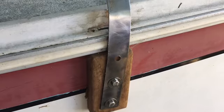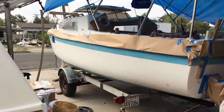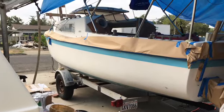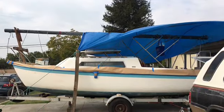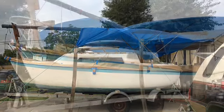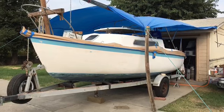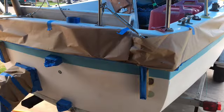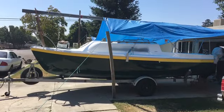There are the chain plates — I left those original but moved them outboard and sealed off the holes. Here I am painting the boat. I used two-part Interlux paint, worked great. Sanded it down with 180 grit until it was nice and smooth — you can see the red stripe went away — then wiped it down with acetone and sprayed it with a cheap gravity-feed spray gun.